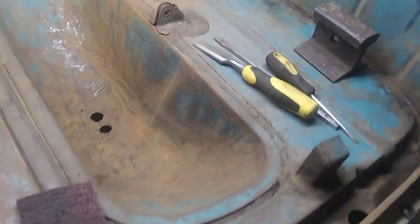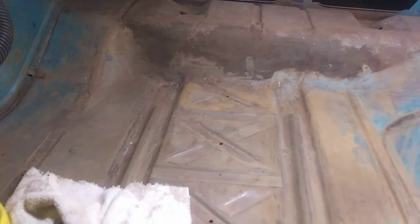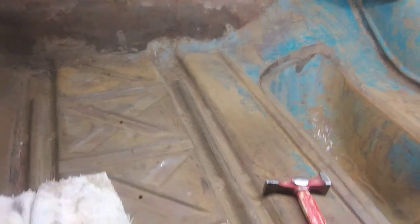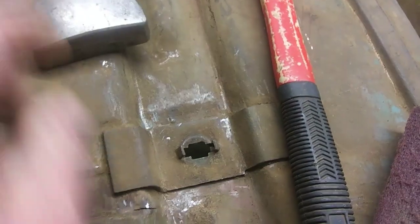There's the trunk - I've been getting the surface rust out of here. There's that wheel well for the spare tire - it'd be nice to put a tire in there. I think I can have the rest of this trunk for other stuff - a toolbox, and maybe a cooler for the car shows, some oil. It's got the old original paint in here. I've just been hitting it with a Scotch-Brite pad. We'll probably put some rust converter all in here. You can see there's that crack right there - I'm gonna weld that up; that's where the tank straps go. There's a crack there from the old shocks too - I'm gonna weld that crack up. It'd be pretty hard to weld in there so I think I gotta do it from the bottom, but no big deal - she'll be nice and strong.